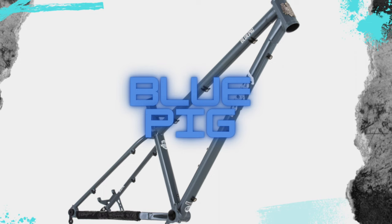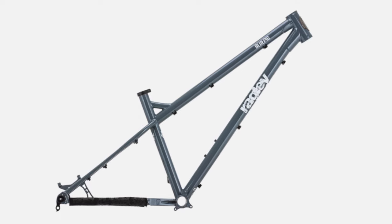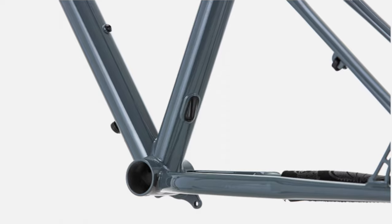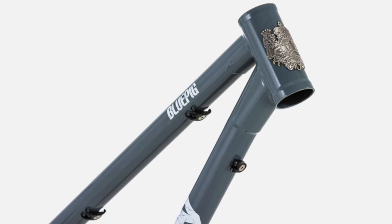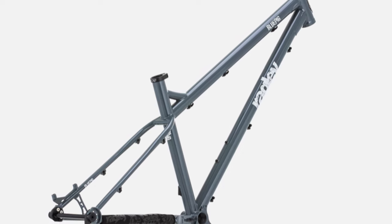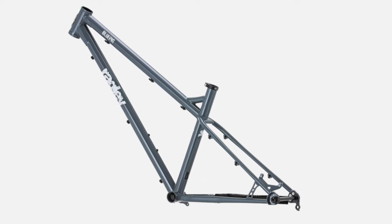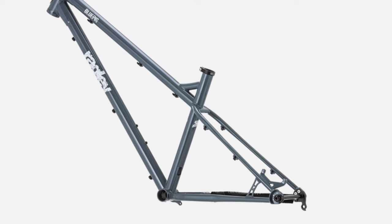Next up is the Blue Pig, which is Ragley's steel enduro bike — basically the steel version of the Mbop. It's made of 4130 chromoly steel, built around 27.5-inch wheels, designed to run a fork between 150 and 160 millimeters, with 425-millimeter chainstays. The changes mirror the Mbop: the head tube has been slackened to 63 degrees, the seat tube angle is now 75 degrees, and the reach has been increased across all sizes to 430 millimeters in the small size, increasing 25 millimeters with each bigger size. The bottom bracket has dropped 5 millimeters, and the wheelbase has been increased to 1,182 millimeters in the small size, increasing about 20 millimeters with each larger size.